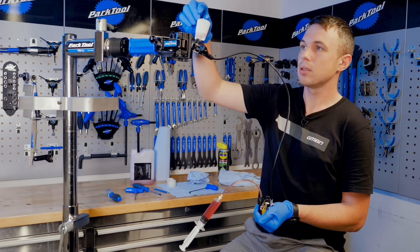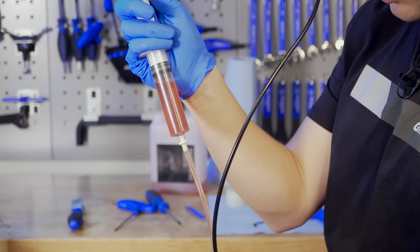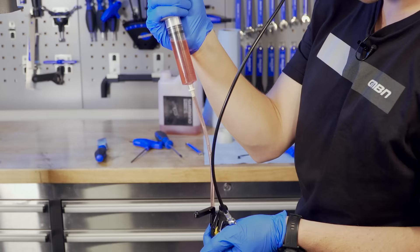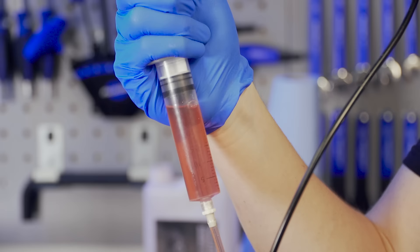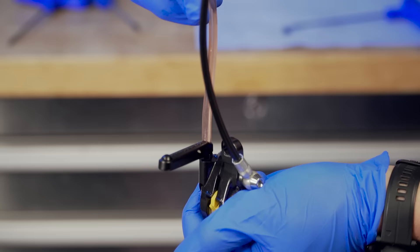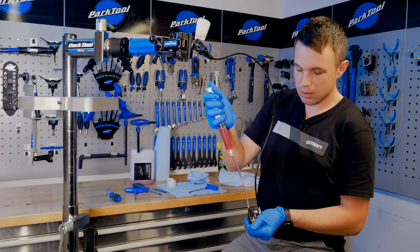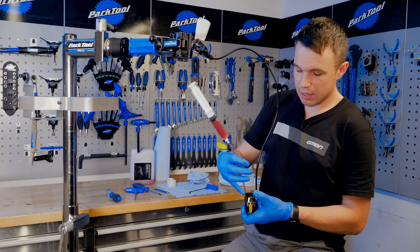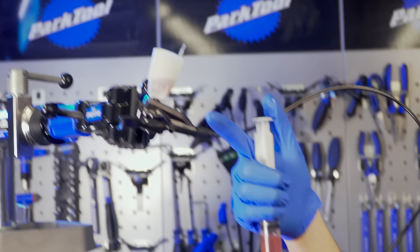The reason we have a little bit of oil in the bucket first is that as we remove the plunger we tease it back slightly to begin with. We do this for two reasons: one, to remove any air — even those tiny bubbles we could be forcing into the system; and two, it's a really good way of inspecting the color of your hydraulic fluid. Even if it gets really dirty, you can still flush out the system very effectively. It just gives a good idea of what's to come and it's a good habit to get into. With the bleed nut nice and open, push the fluid down and you can actually see it filling up in the bucket.